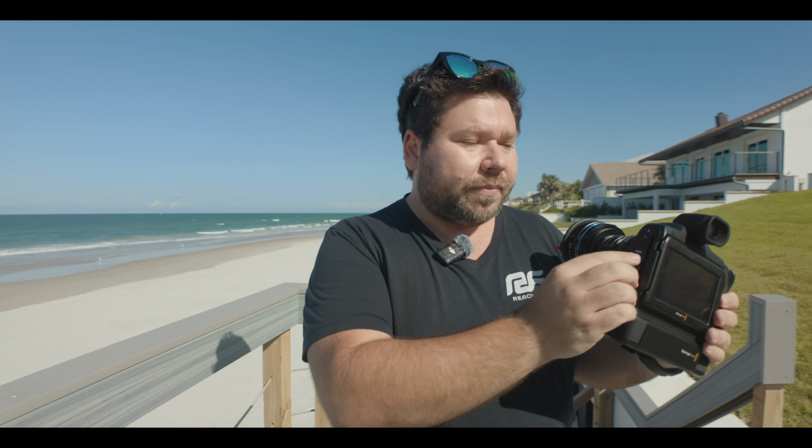Now, a few things to mention. When it comes to powering this camera continuously, if you want to do it via power delivery, you can, but it's going to require a special cable to adapt to the AC power. I'll have a link to that in the description as well. When it comes to USB-C, you're only going to be able to charge the batteries. You're not going to be able to actually power the camera through USB-C unless you have that special power delivery converter to the AC adapter. So just do keep that in mind.